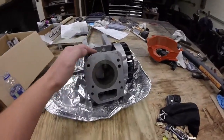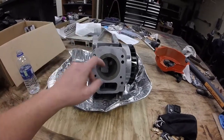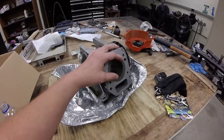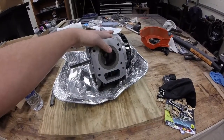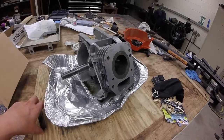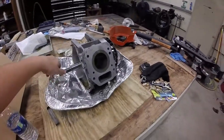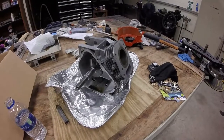We tore it back down and took a look at it — it looked like prior teams had tried running it without any oil. The crankshaft was scored really bad, and the cylinder wall is actually oversized, just worn out of spec. The piston that goes in here is custom, so there's not much we could do besides resleeving it back to the proper size or getting an oversized custom piston built. Most places won't make just one piston — they want to make four, and it comes out to about $700, which we just don't have in the budget. Hopefully a future team will take what we've done and apply it to this downsized engine, because it's all about efficiency.